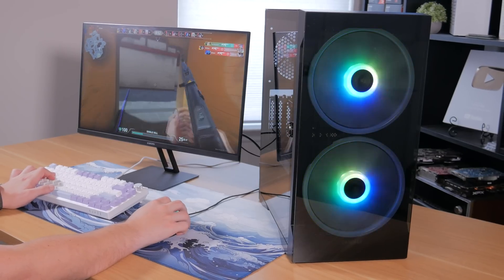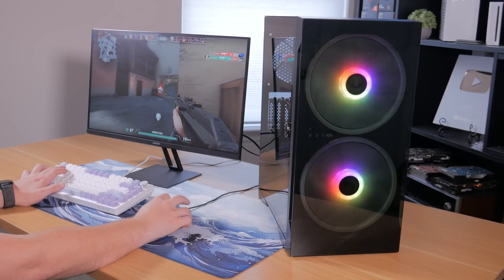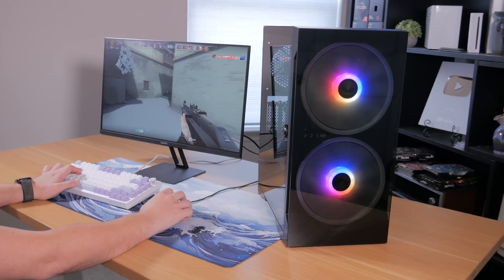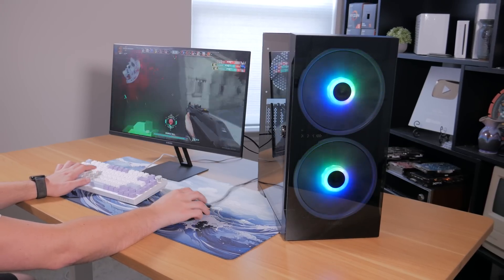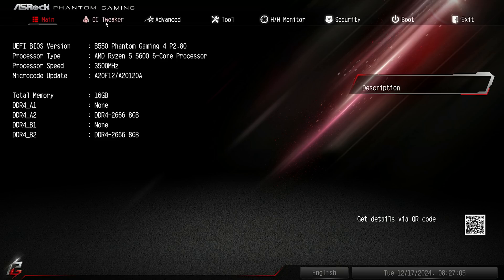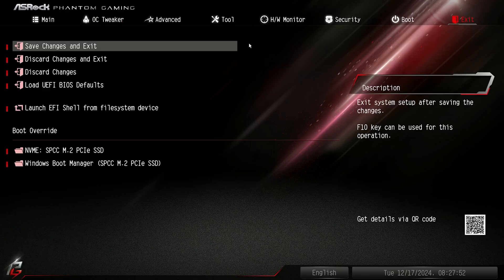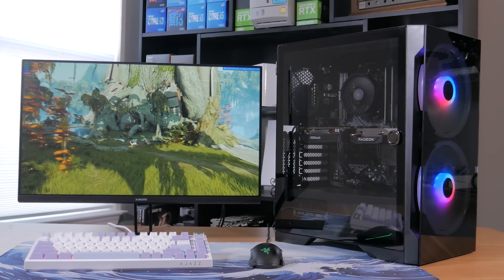The system is built, but there are still a few things to do before you can start gaming. The first is to install an operating system — I'll leave tutorials for Windows 10 and Windows 11 in the description, which you can run for free with the only downside being a watermark in the bottom right corner. Once your OS is installed, you'll need to install chipset and graphics drivers, both linked in the description. Once everything's working, power off the PC, power it back on, and immediately start pressing the delete key to get into the BIOS. Go to the OC Tweaker tab, under DRAM information select Load XMP, and change it from Auto to Profile 1. Then under the Exit tab, select Save Changes and Exit, and hit Yes to confirm. Your PC is now fully complete and you are ready to start gaming.